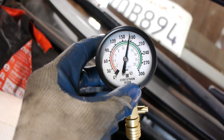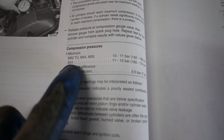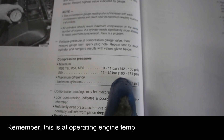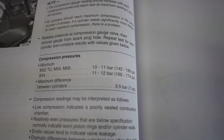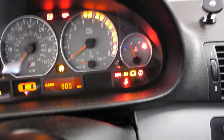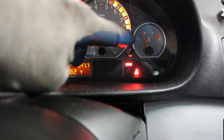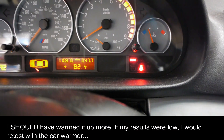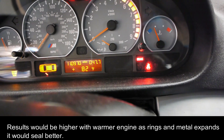All of my cylinders basically came in between 170 and 175 psi — this one looks like it's right around 174. According to the Bentley manual, the S54 compression results should be 11 to 12 bar, which is 160 to 174 psi. Maximum difference should be half a bar, which is 7 psi — so minor and definitely within 5 psi of each other. My engine temperature is not at full normal operating temperature; oil is definitely on the colder side and coolant too, since I only idled it for about three to five minutes. I'm happy with the results.